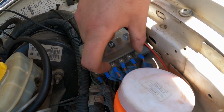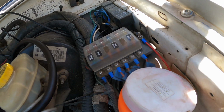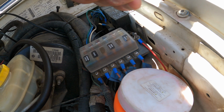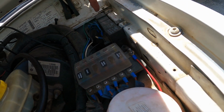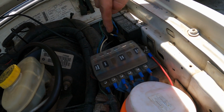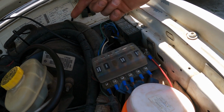I could have used less wires. Each switch has its own power wire. They could have all had the same power coming into the switch, since all they do is trigger the relays, which has 12 volt power going to each relay and sends the power to my accessories.